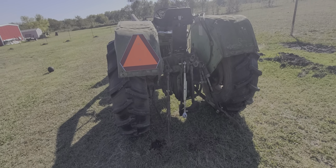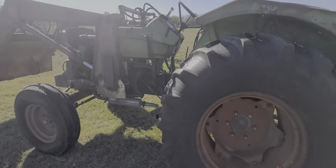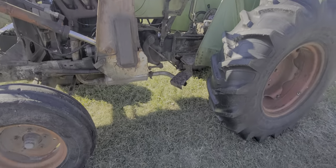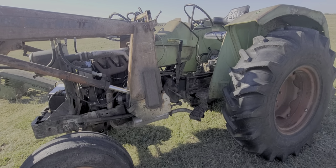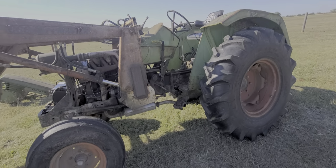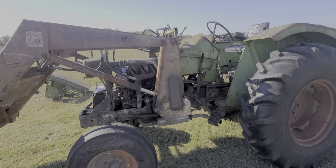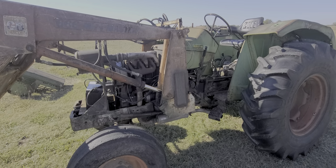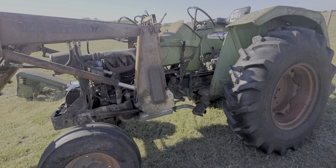So they're a little bit ground, but there is an opening underneath the transmission. I opened it and I was able to access most any gear over there. And I used the multi-tool and oscillating tool, and I shaped those gears a little bit, and they're now in a better condition, and it shifts really nicely. It's literally no grinding now, so I don't think I even have to deal with the transmission anymore.